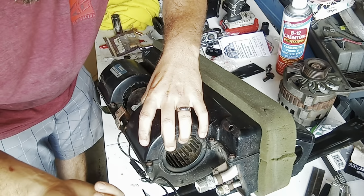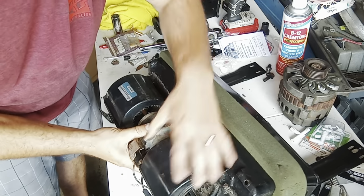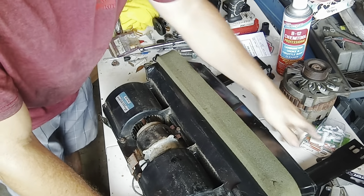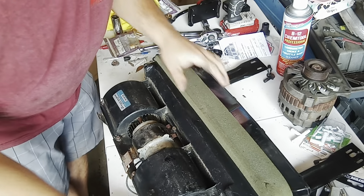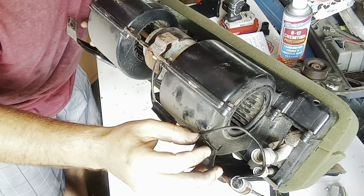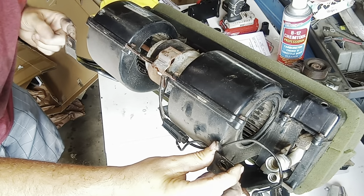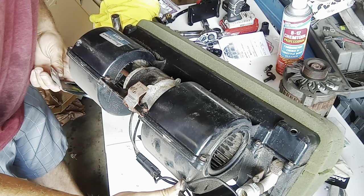And there was mineral oil coming out of that when I took it off, so don't let that stuff drip all over you. But I just wanted to show you all that. And as far as getting this off of the ceiling, if anyone's curious, there were two screws on either side of here. I think it was 7mm. And two here. One there, one over here. And those were 10. So those, you take those four screws out and it'll come down.